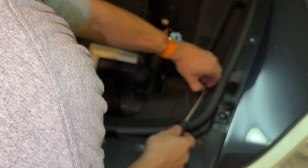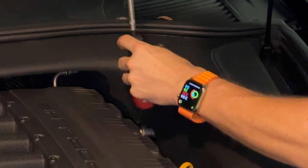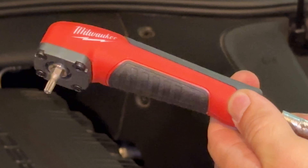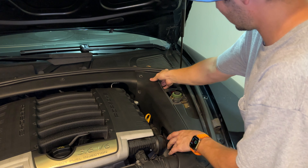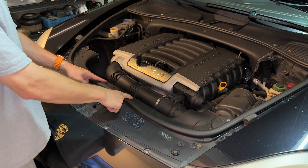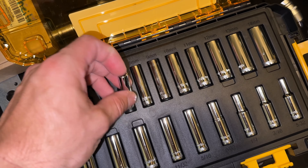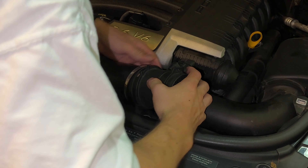On the right-hand side, there's a screw here that you can't see me undo thanks to iPhone's autofocus, but we can see the empty spot — there should be one over here that you move in the same way. This is T25. For some steps you do have to wiggle it to get it out from under the trim — don't despair if it's not straightforward. My air intake hose is broken, so you don't see clips on the right-hand side. First, press in on the clips that should be on this hose holding the mass airflow sensor unit of hose, and pop it out — it might take some force.